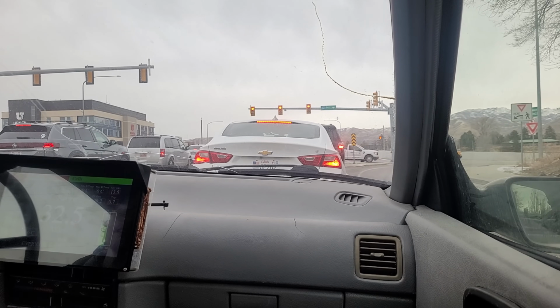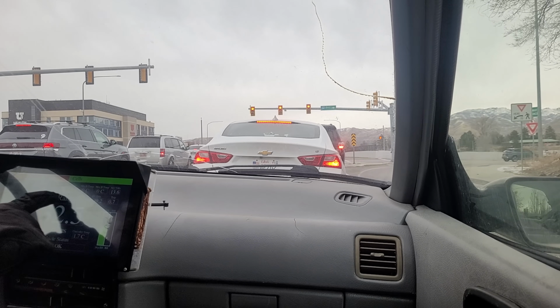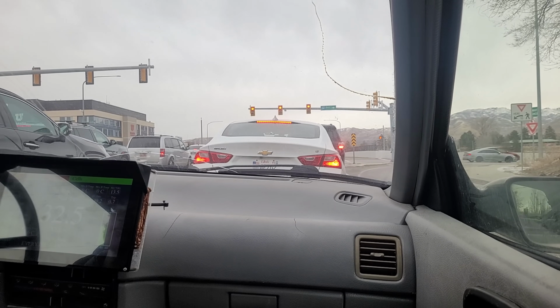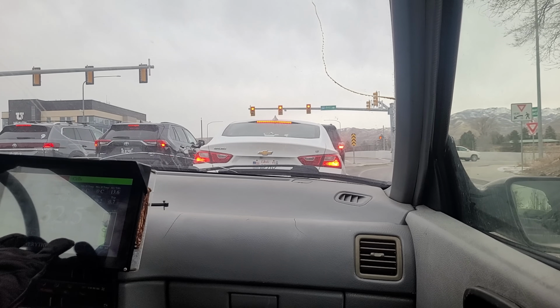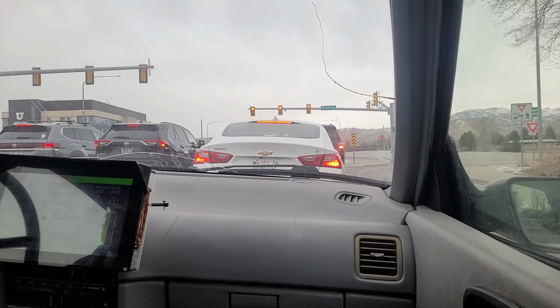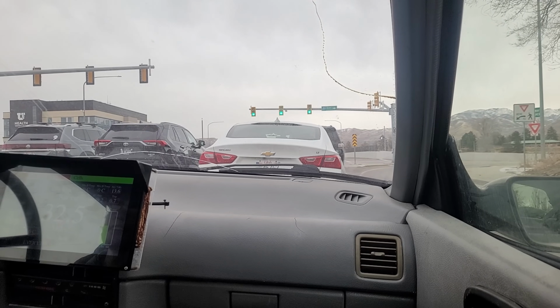And so when I'm just sitting here idling, I'm consuming about 2 amps at 110 volts, 220 watts, pretty minimal. My motor and controller temps are both like 1.6, 1.7C, so they've already gotten a little warmer just from that first mile of driving.